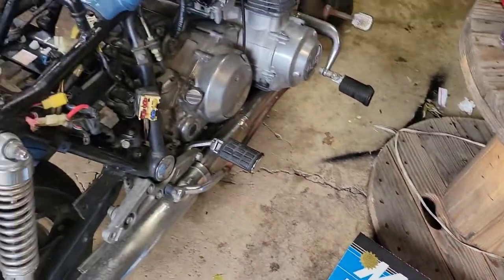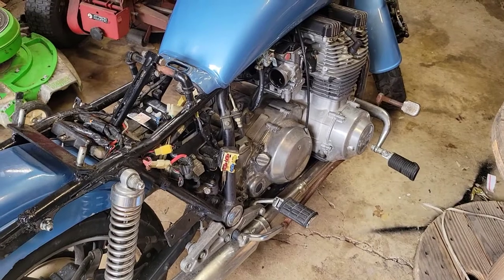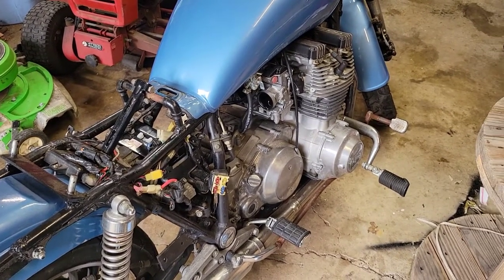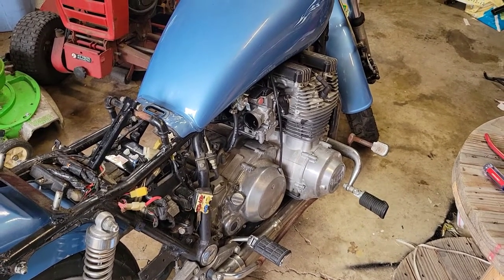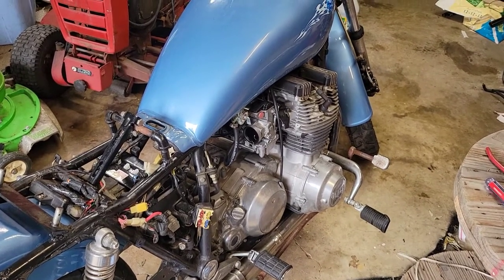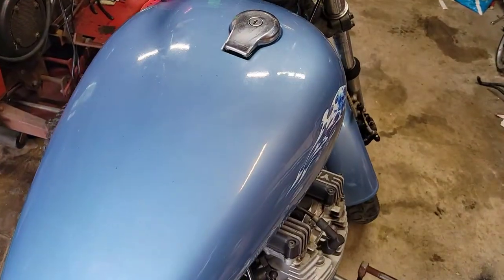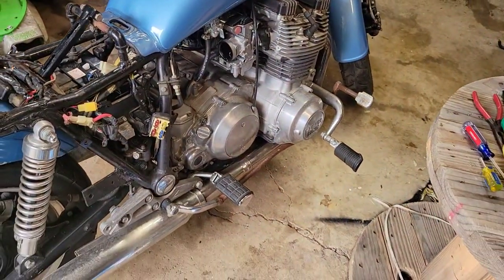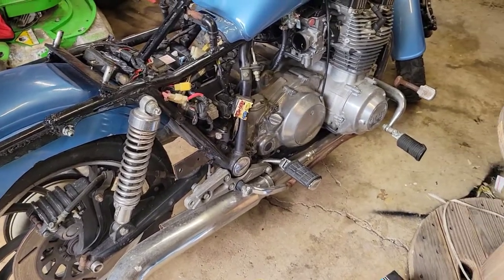Seriously. So, all right, just want to say thanks for watching. I am over here sweating to death. And as you saw, that was a very easy first startup. All I had to do was choke it once I got the primers going, accelerator pumps, and I just had to turn up the idle a little bit for the choke. And after she warmed up, I got the idle set at a little above 1100, just because. But she is good to almost go, maybe.